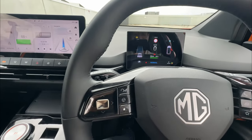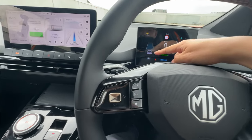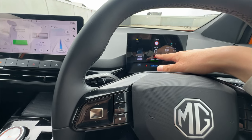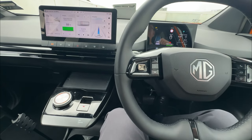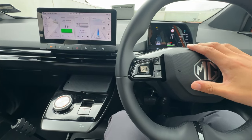The vehicle will give a sudden stop, engage the parking brake, go into park, and at the same time the ready sign is released — so the motor is switched off. This is useful in an emergency situation where you didn't realize you were in drive and tried to get out the door.